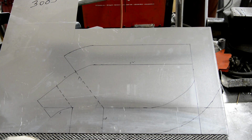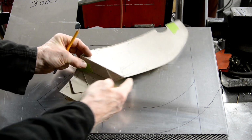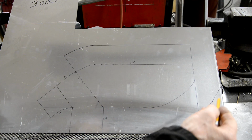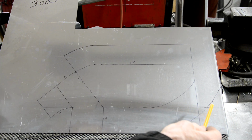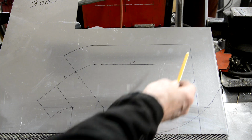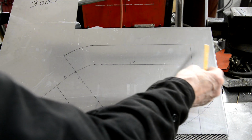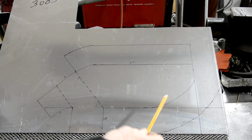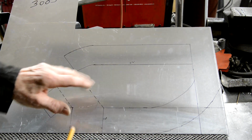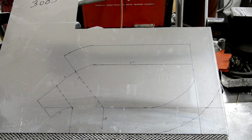We're going to cut that, which is there, because that is going to be that piece. But as I say here, because that moves away, the part that folds over here isn't going to touch that completely, so we've got to have a little bit. So hopefully this has given us our 2.5 inches. If I cut this out all the way, actually that one's cut in a corner like that. This is our cut line, this outside one, all the way along there. I'm going to draw that in or I'll forget it. Then we'll make our piece of wood this shape and thick enough. It's going to be 2 thicknesses of plywood and we'll cut our curve in it, but you'll see all that in a minute. So let me just draw that little piece in there and then cut this on the bandsaw.